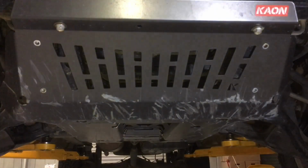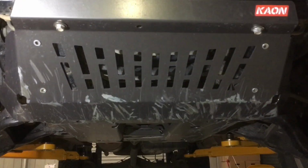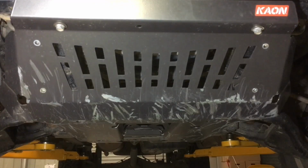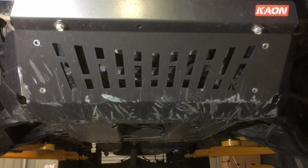Okay, we've got the Dobinson suspension in the front, the 220s, that is the correct listing. In my opinion, they're absolutely maxed out or borderline on being a little bit too long. The passenger side's good, but the driver's side's the problem, and it's not because of the suspension, it's more because of the diff mounting position from factory. And if we're going to improve it, we may as well improve it a bit extra. Now let's get in there and show you what I'm talking about.